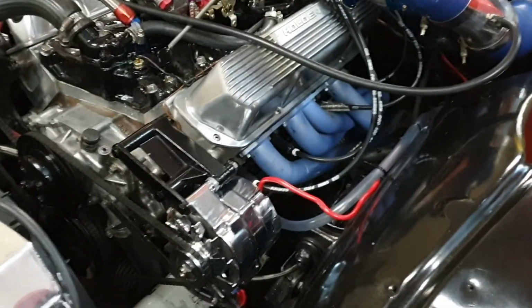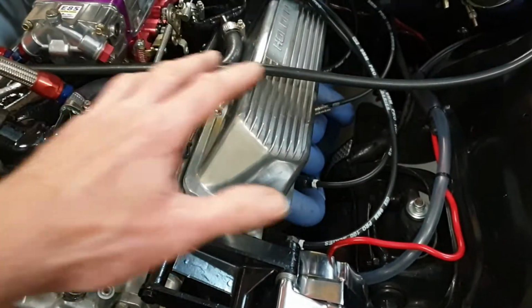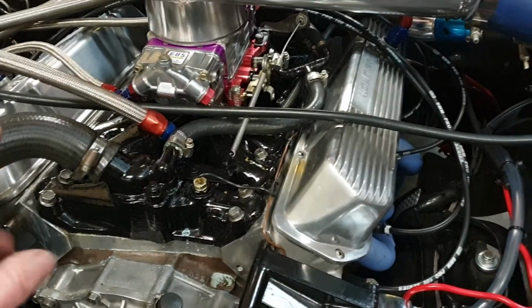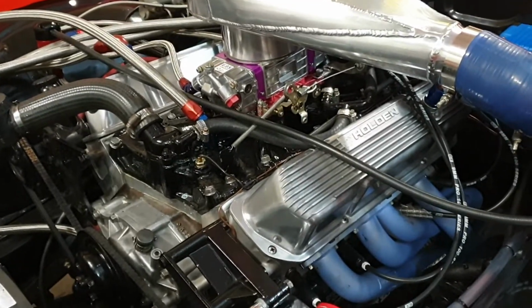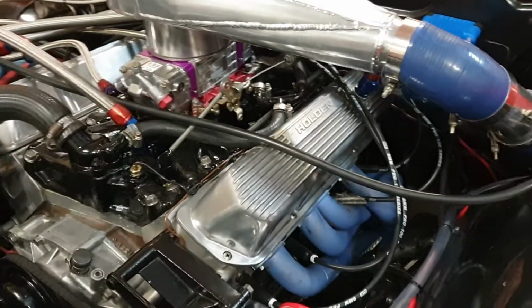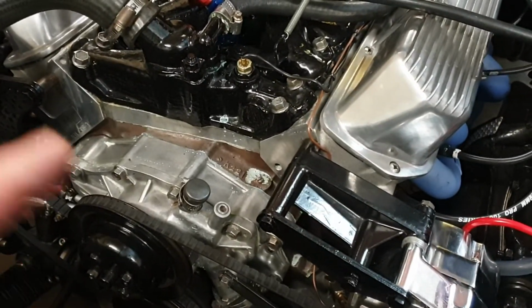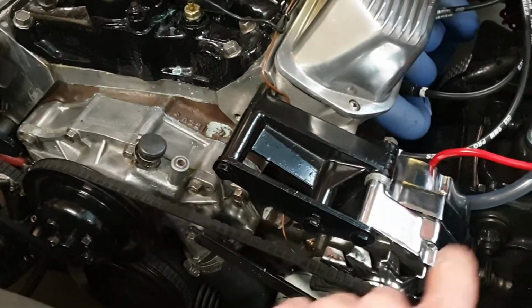Well, I had this little ticking sound in it, guys, and it was bugging the hell out of me. I thought it was coming from around this area here. I had all the valve covers off, and I checked all the clearances on the rocker gear. I had all the plugs out and did a compression test on it, which is really nice anyway. It's satisfying. It all comes within spec, a few pounds of each other. So very happy there. But this little ticking sound, sort of every revolution or a random come and go, was really weird. What it turns out, it's this stupid thing here.